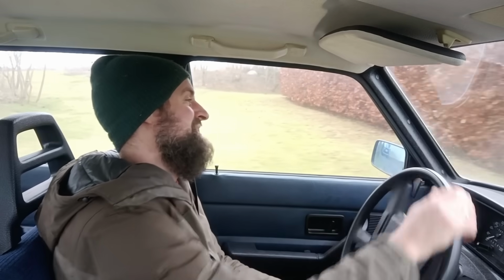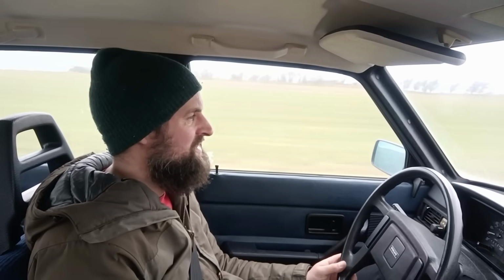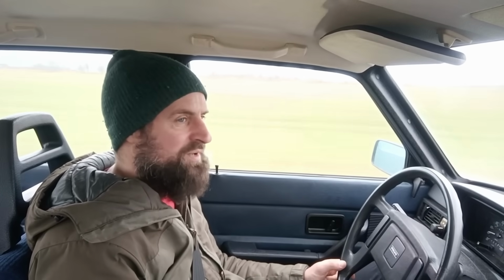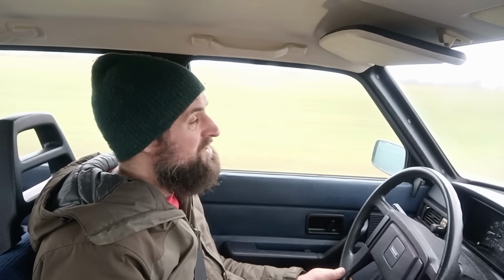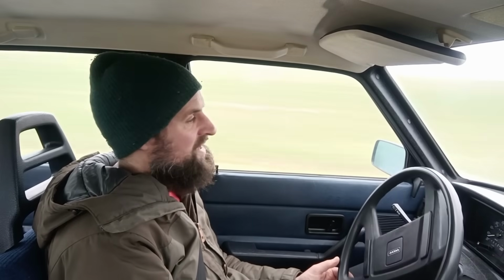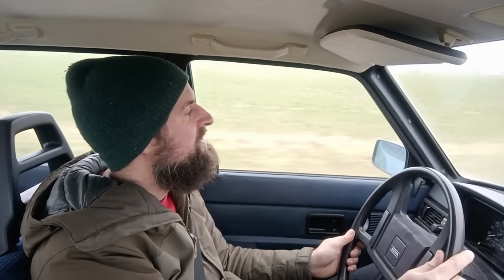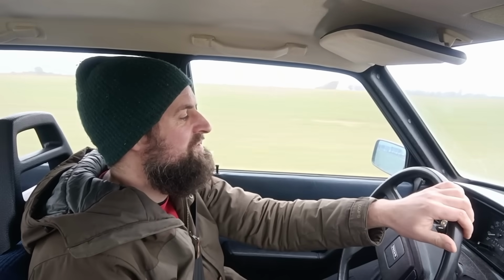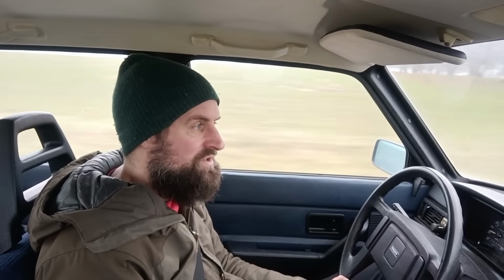This is such a tank to drive. It's really, I just feel so safe in this car. So far so good. It drives perfectly on choke at least. But I want to heat it up and then give it the beans to see if the torque that I was expecting this engine to have is there now. It's definitely going to be different because 10 degrees of timing will alter things quite a lot. It will be difficult for me to say if the fuel consumption is better, because I would need to drive quite a bit to measure that. But I expect it to be, to be honest. So, I will take it back once the engine is hot, so we can give it some throttle. So that will be a while. It's a big engine. So see you in a bit.